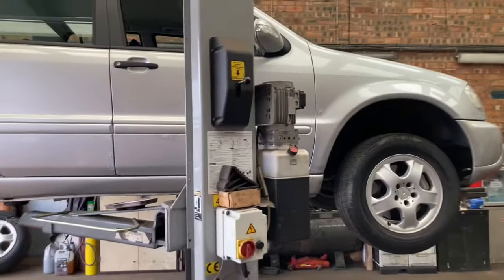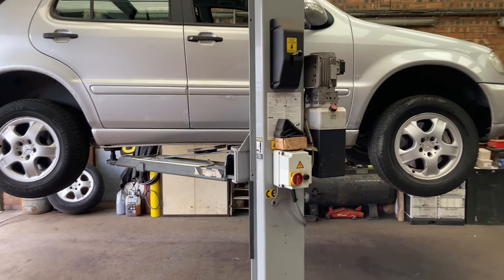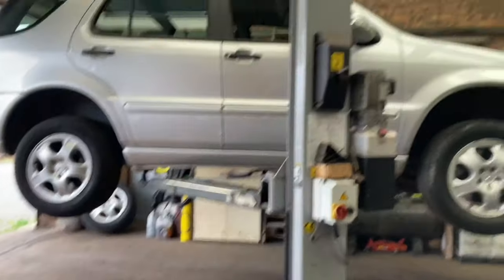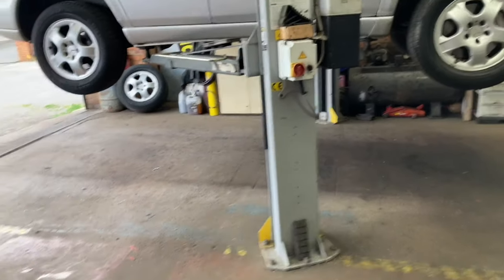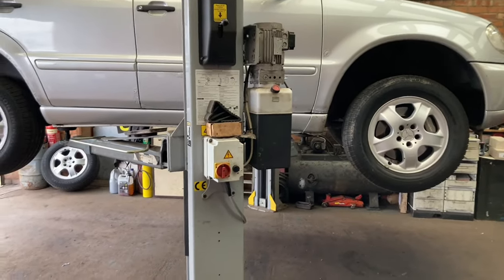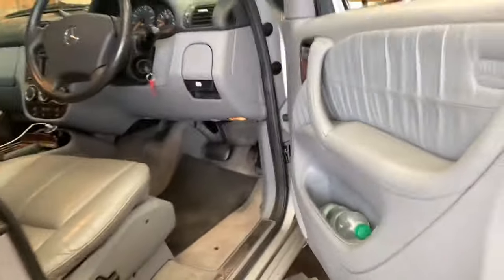Comment on the video if you're in the ML Owners Club — does anybody find that the way the throttle works on these is horrible? It's very notchy, especially in slow-moving traffic. You've got to put a lot of effort on it for it to move, then all of a sudden it hits a notch, frees up, and you go lurching forward in this automatic. I've been onto Mercedes — I believe there's something you can do stretching the spring on the throttle position sensor under the bonnet, but I think the cable's getting hard up and the pedal has got loads of side-to-side free play. You press it: a bit more pressure, a bit more, then it drops, and at that point you're lurching forward.